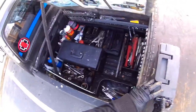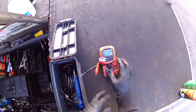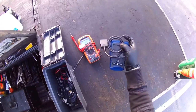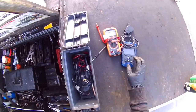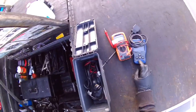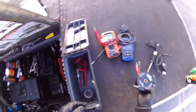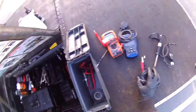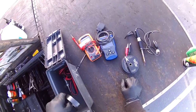We'll move on to the electrical side of this real quick. Get yourself a good voltmeter — it's got a diode tester on it. Scanner: any cheap scanner will do, but I prefer this one because it does ABS systems also. SRS is important to check the airbags. Very important. Soldering iron. Some test leads. I've had to run voltage over to the OBD because for some reason, even though I checked the fuses, there still wasn't voltage going to the OBD. I had to force 12 volts to it to get it to scan.